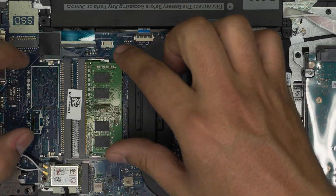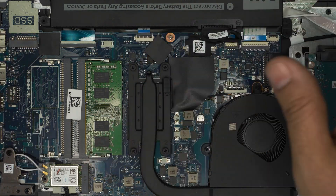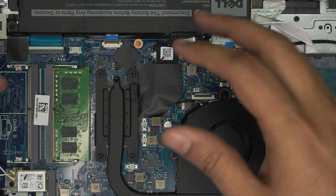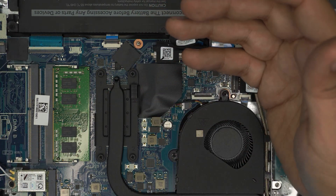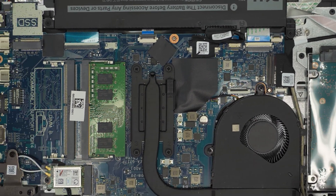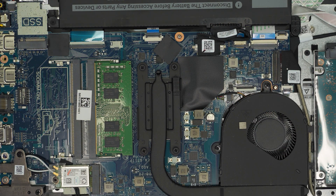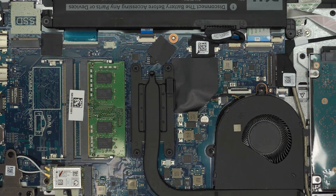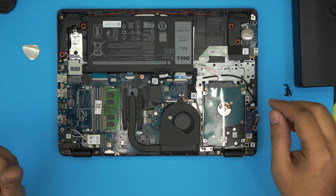Here's a useful trick: when some people install both RAM sticks — whether 16+16 gig or 8+8 gig — they turn on the laptop, everything spins but there's no image even after five to ten seconds. Don't panic. All you need to do is power off the laptop, swap the positions of the two RAM sticks, and try again. It will work because the BIOS needs to adjust to the RAM and perform a memory check.